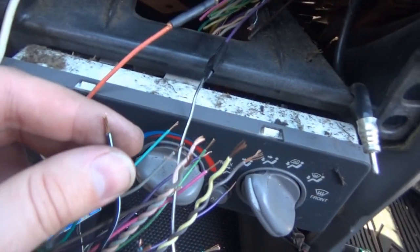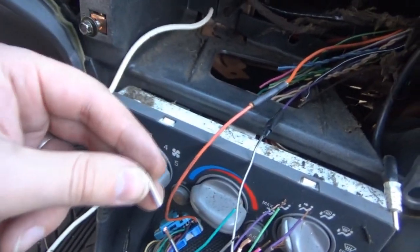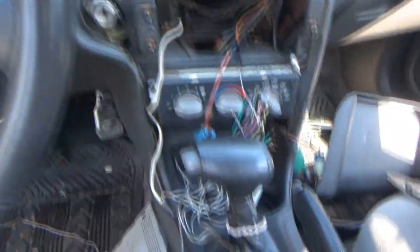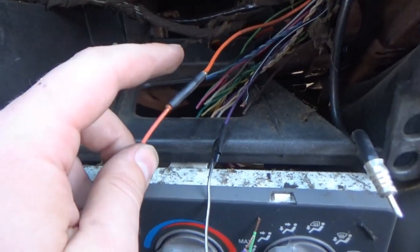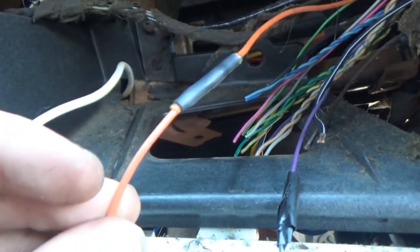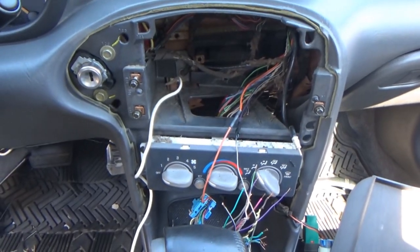But obviously, we take one of these ends that are cut, we take one of these little crimp connectors, you twist the wire first to make sure it goes in, but basically you get the idea. You slide it in here. Then you take the other end and put it on the other end of that. Then you take your crimpers and you squeeze, and that flattens it out so it traps both wires together. Then you have your heat shrink tubing, which is what that is. Make sure you have it on the wire first before you do your crimp. Slide it over the top, take the butane torch, and it'll shrink. You see the goo coming out of it. It's like an adhesive on the inside. And that's it. That wire is now together, and it should not break. We shouldn't have any problems with that.